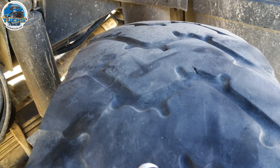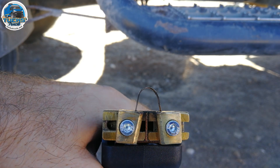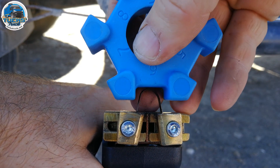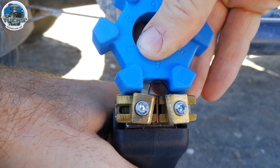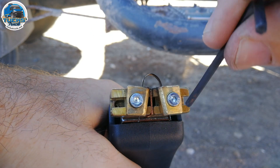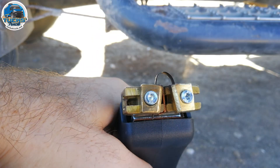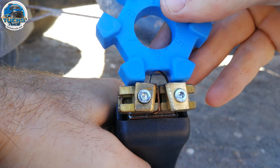This is the cutting tool with the blade fitted into the head. We said we were going to set it to 6 millimetres, so using this gauge here — this is the 6 millimetre depth — we put it on top of the tool and slowly push it in until we get the correct depth set. Once that's set, we just tighten up the two allen bolts, then double check we've got it right: 6 millimetres.